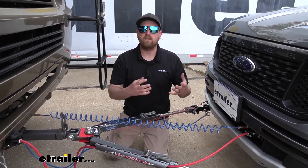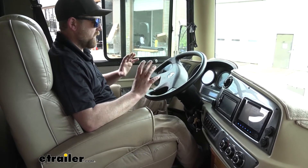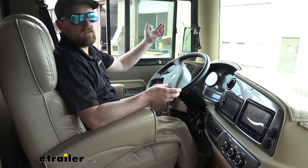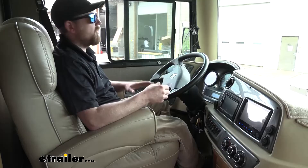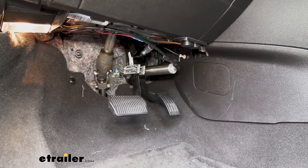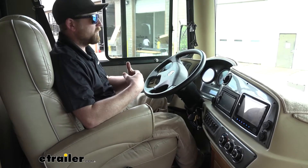The Ranger's going to hit the brakes when you want it to, not before or any later. The Ranger's brake pedal is applied at the same rate you apply the brake pedal in the motorhome. For example, rolling up to a red light and you're halfway on the brake — the Ranger does the same thing. On the other hand, if there's an emergency and you really hammer on the brake pedal, the Ranger's going to do the same thing. Overall, it's just going to be really smooth and a much safer stop.